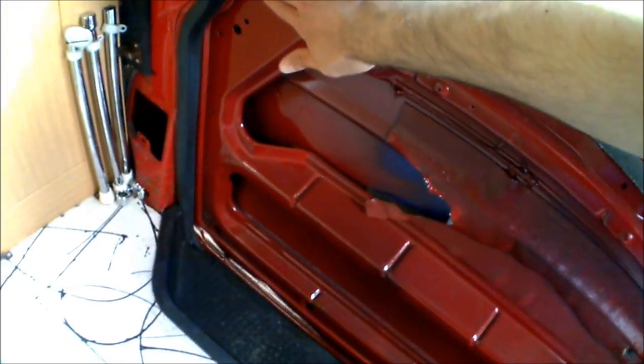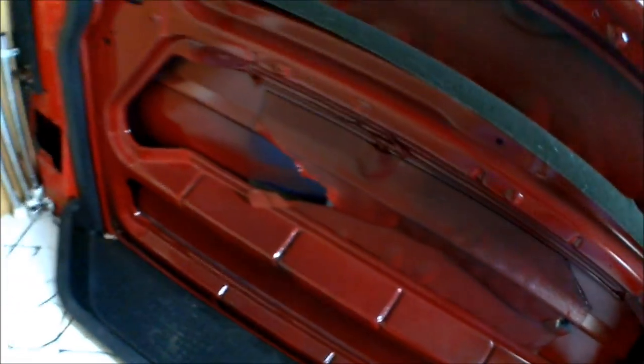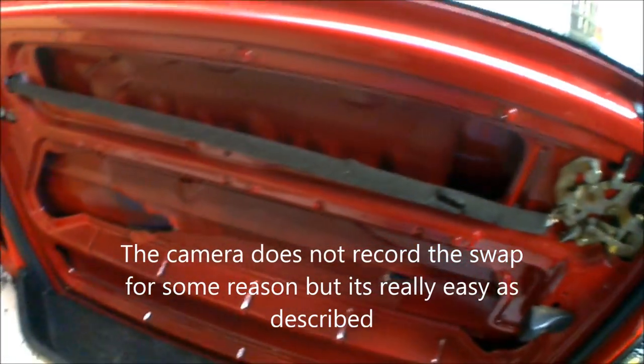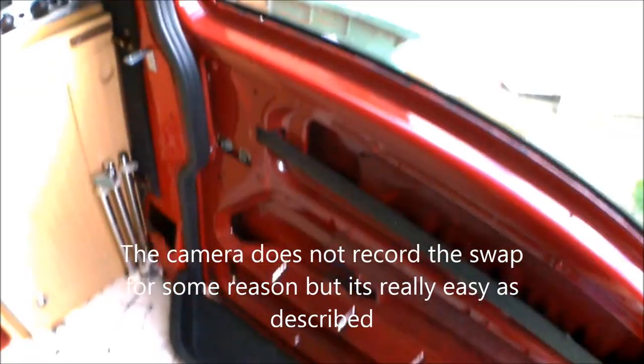To actually remove the door, you can get it off pretty much just by taking those two bolts off, and there's a runner on the other step — I've actually taken mine out already. There's two bolts, one there, one there, and there's a stop underneath. Just take those two bolts out and the door will then slide all the way out. The bottom runner will slide all the way along and out of the channel, those two bolts undo the side runner, and then you literally unhook the top panel and the door comes away. I'm waiting for my nephew to come back so I'll get a bit of help, but I'll film taking it off and fitting the new one to show you how easy it is.